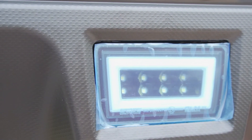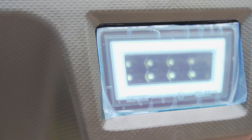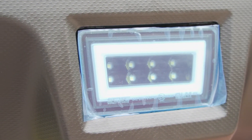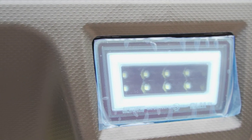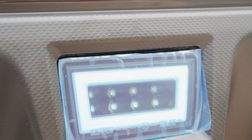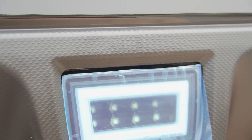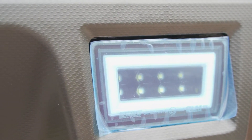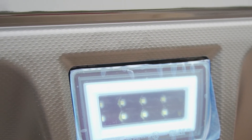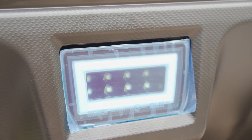In order to get this third brake light in, you have to angle it slightly up and slightly tilted in order for the push pop to fit in as well as that screw we put in with the bracket. If you try to do it any other way it won't completely fit and it'll look sideways. AJ is now putting in the two bolts — one at the top, one at the bottom — securing it and making sure it is all good.